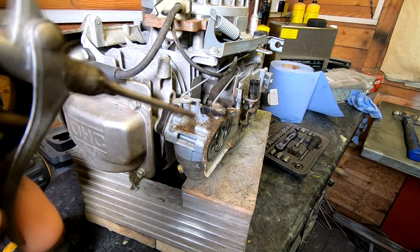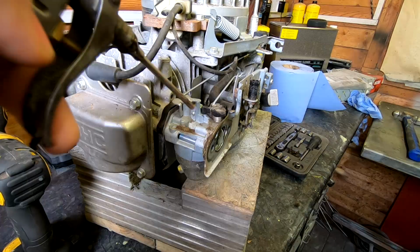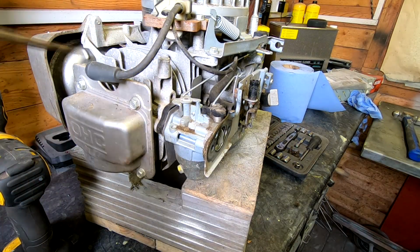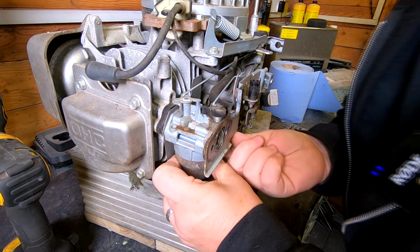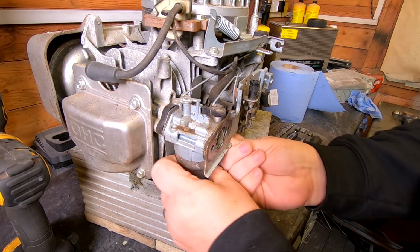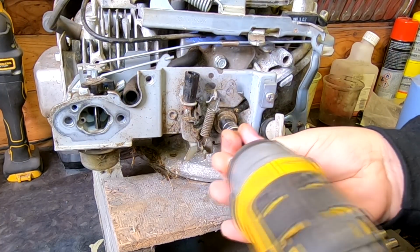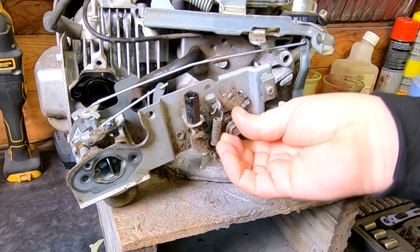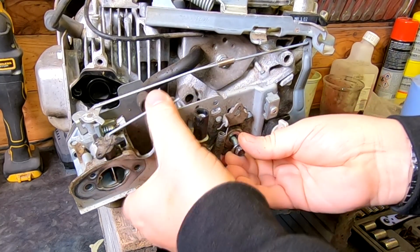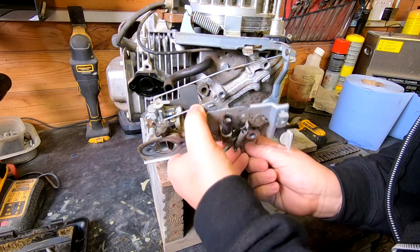So I like to just clear away some of this, just to get rid of some of that crap that's around the engine. And we've got the fuel line, which is always very tricky on these to undo. So what we can do is literally just loosen off this nut here. And that brings a whole lot out. Like that, that bolt. It's only one bolt, look. And that just brings everything off of there. Clip your spring off from the bottom there. Tip that out.